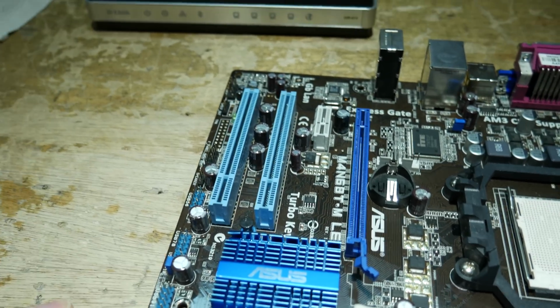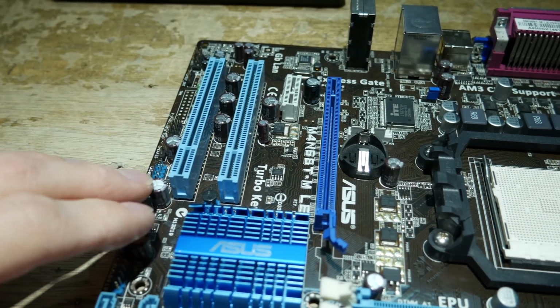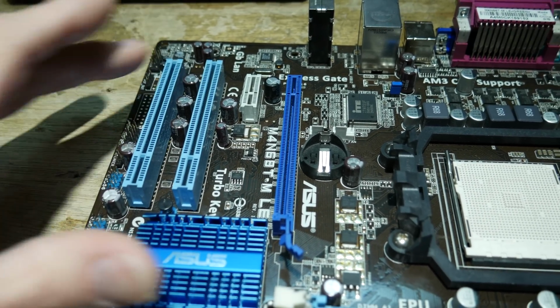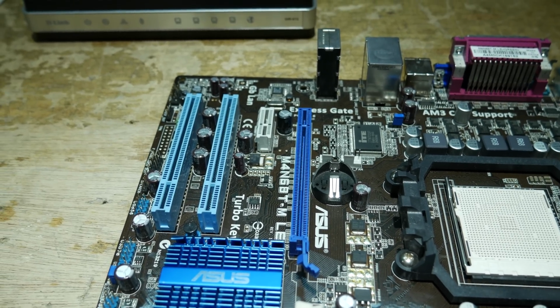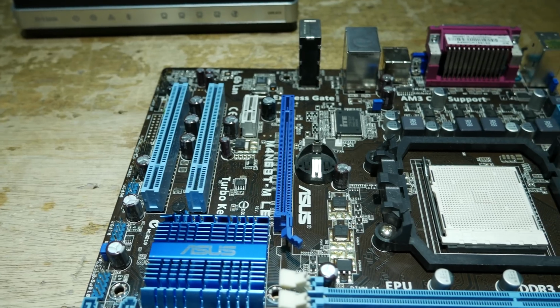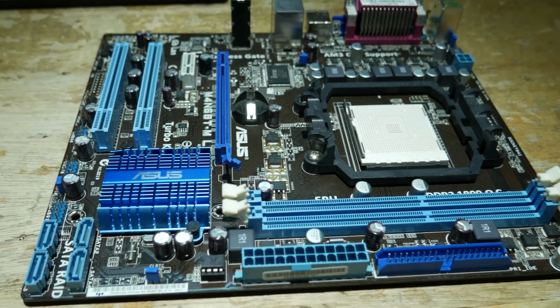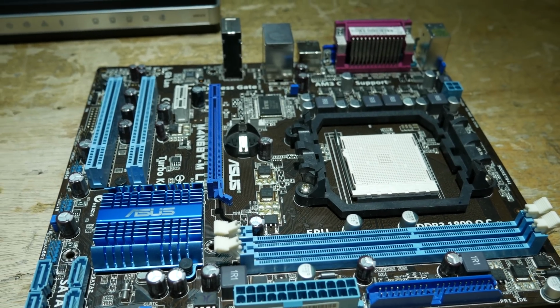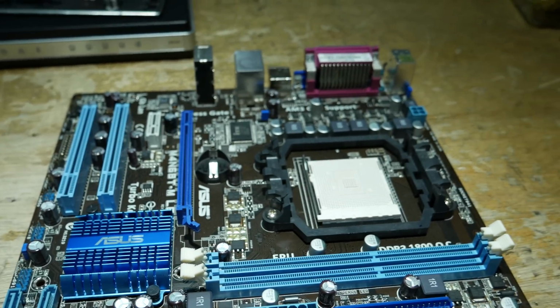I can tell this is a little bit older than most of the other boards I've worked with on this platform because it still has a lot of electrolytics on it. And in fact, they're the Chemicon KZG, which they've had some bad runs of and they're notoriously defective, but these appear to be okay, so hopefully they're going to be alright in the course of time that I need to use this motherboard. But I suppose even if they're not, I'll just do a repair video on it.